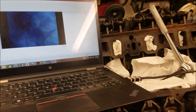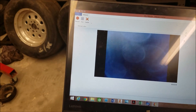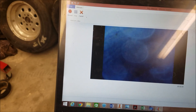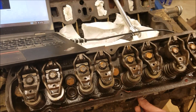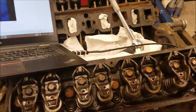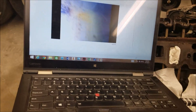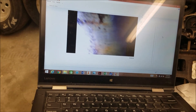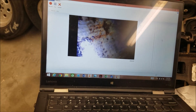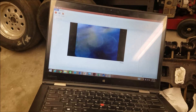So it's kind of weird — it's like a remanufactured engine, but it's either been re-ringed or bored, because if we look really close you can see some cross-hatching on the cylinder bore. When engines sit for a long time in a humid state, moisture will work its way in through an open intake valve. It was indeed this chamber that had the open intake valve. All the other ones look good, but this one has a significant amount of rust around the top. Should be able to scrape most of it out — it all looks like surface rust, not any pitting, so that looks good overall.